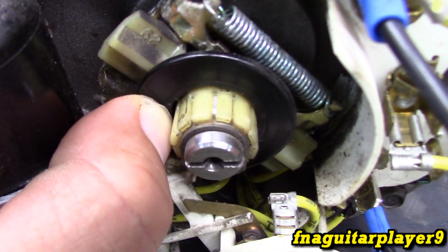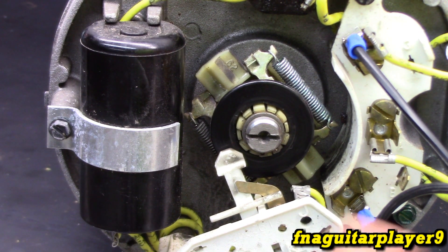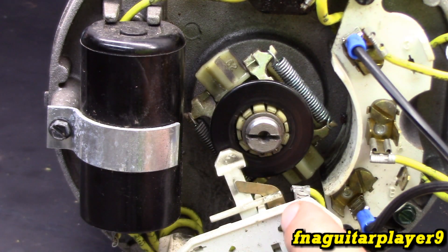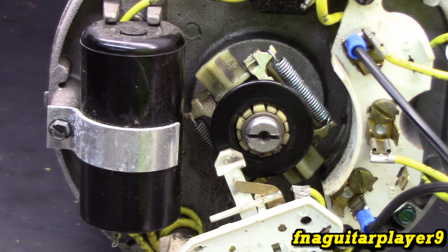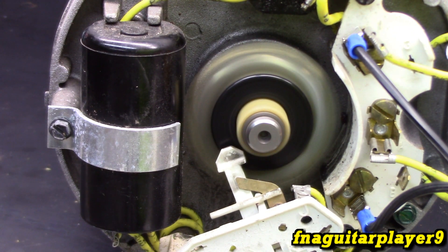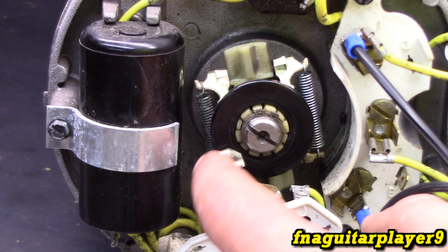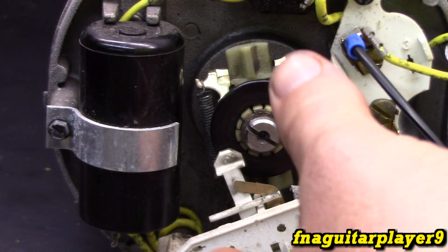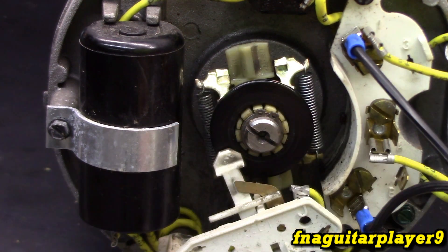You can see how these weights work. Right now until you hear it click, you'll see this go in. As soon as this goes in, that breaks the connection on the starting windings, then it's just the run windings. That's what that rubbing sound is — this arm rubbing on this piece of plastic here. You can hear the motor makes a different sound until it kicks in going up to speed, and then it engages.